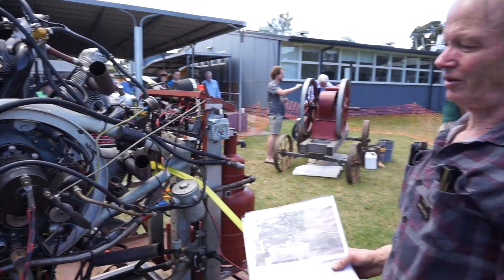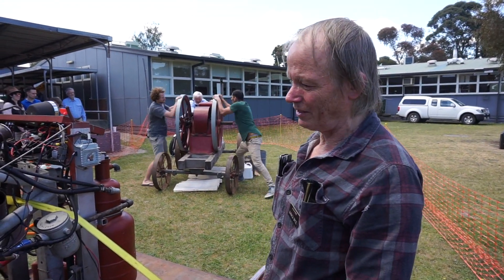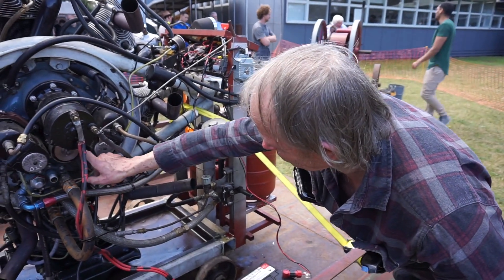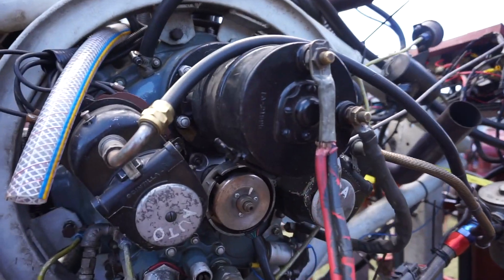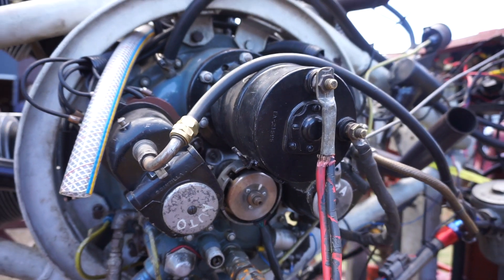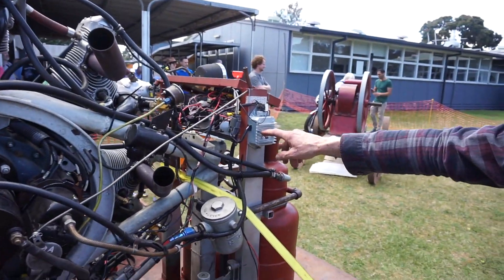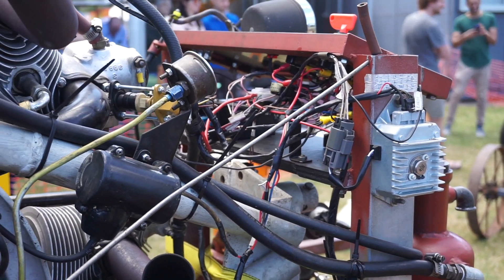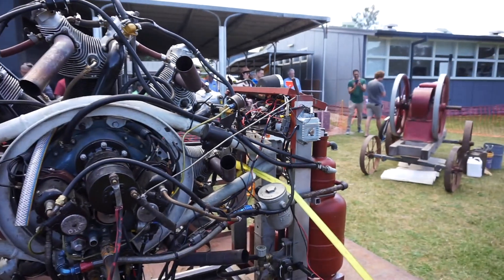This distributor housing here has got a tooth wheel on it and hall sensors, so that picks up the engine speed and engine position. It sends that through this module that turns it into a square wave reference pulse, and it feeds that to the electronic control module, which is part of the calculations for how much fuel to put in.